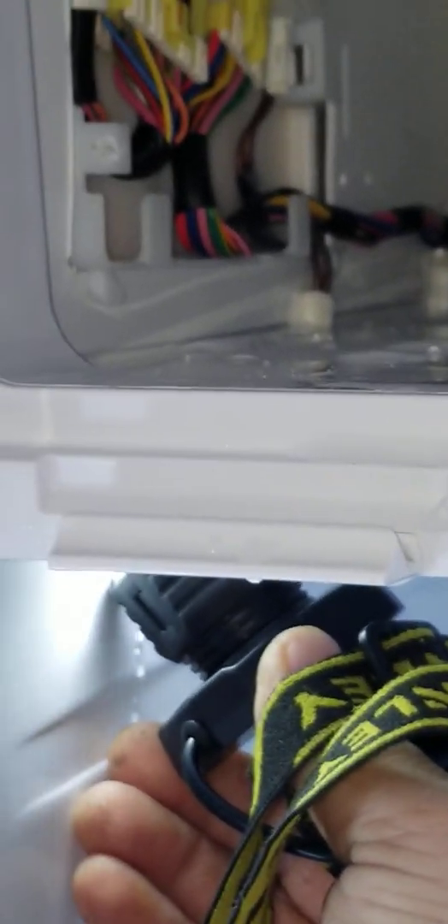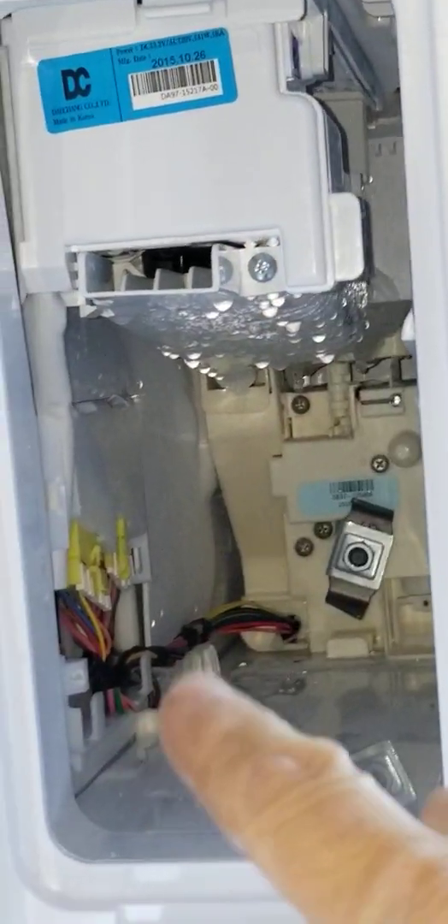The problem these things usually have — I'm going to shine my light through the bottom of this. Looking inside, you can see the light coming through and that shows us we've got an air gap in there. The customer also said they were getting ice buildup at the back. So once we get the ice maker out, we'll remove the auger motor assembly. We've already removed this cover here.